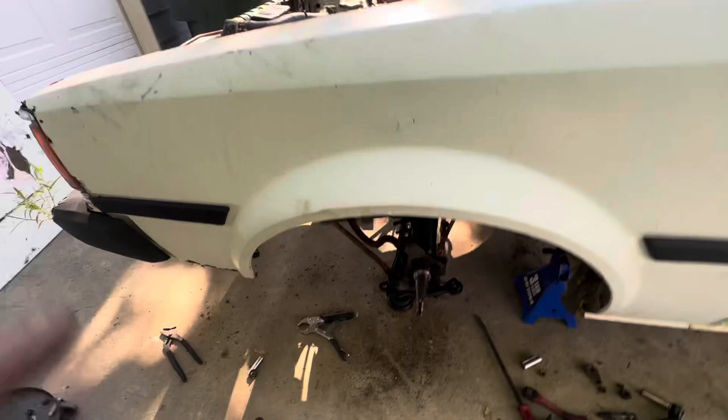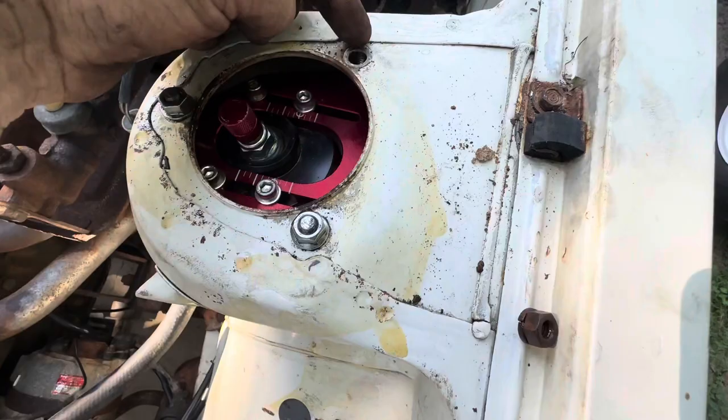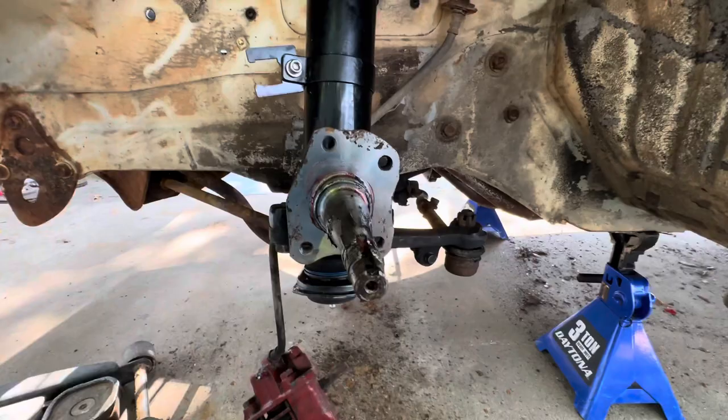All right, so control arms in, we've got our coilover up, but we're not bolted in because, well, remember what we said, it's not gonna line up. As you can see, it's just barely set back from the other three on the AE86 top hat. So we'll just blast that hole out real quick and bolt this thing in. We're gonna move these because whoever adjusted the camber last time didn't realize that the bolts were gonna go under the tower. So we'll move those and we'll be good. The next problem we're going to encounter is, well, this bolt spacing.